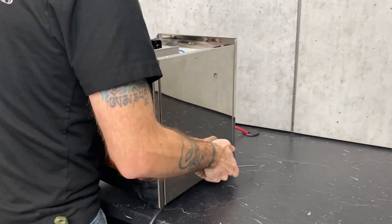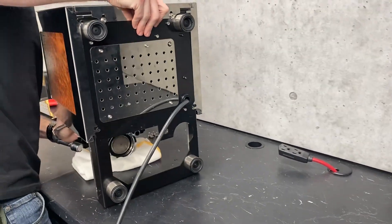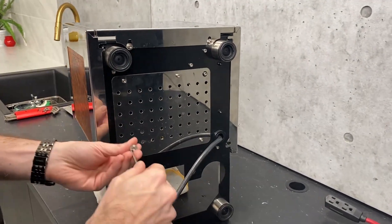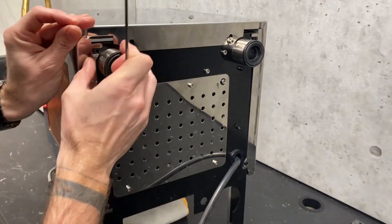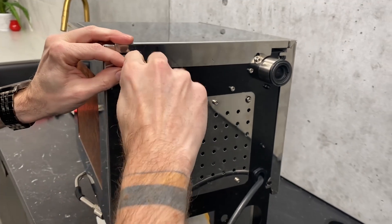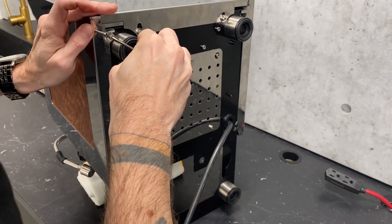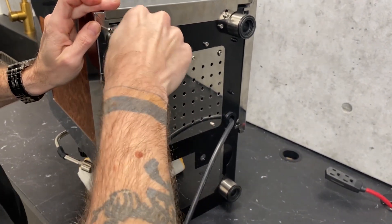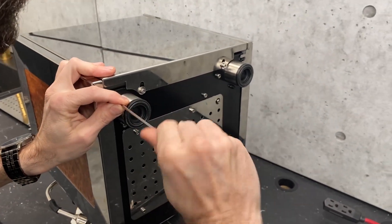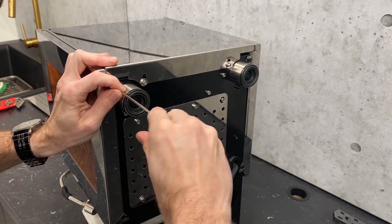You can just keep turning the machine so that every time you're doing each side. I'm going to put it right up face down on this towel here. We've got two back screws in and two more to get in. This is the tricky part — making sure that everything stays lined up. What I suggest is, once you have all your screws started in here, don't tighten everything down completely yet. That way you can kind of shift things around if you need to. Check the seams once you're kind of partially in.